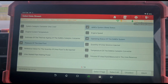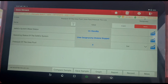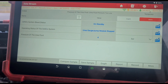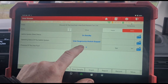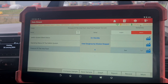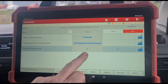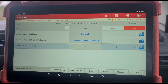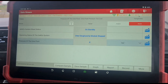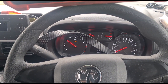Let's just switch the engine off, ignition on — so it's on standby ready and we've got four bar pressure. Now that can be confusing on these; it confused me the first time I saw one, because you'd assume that four bar means the tank is working. But it doesn't — it doesn't read anything below four bar, so you need to get up around five and a half to six bar of pressure, and that's how you know it's working.